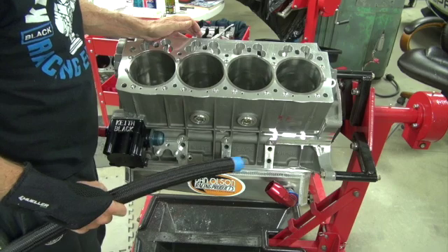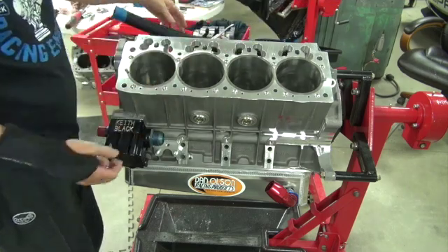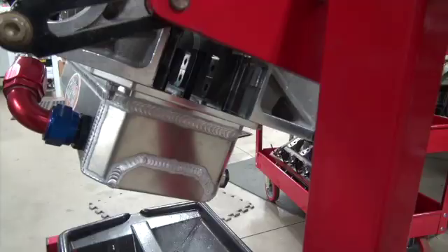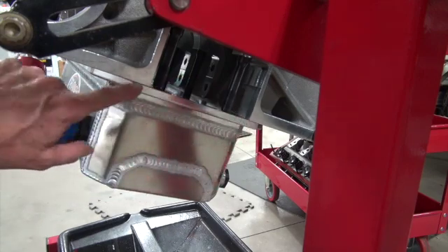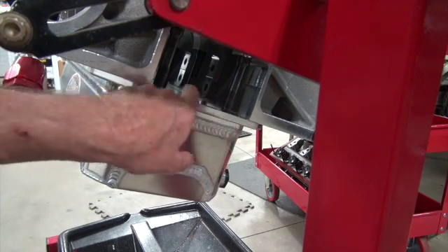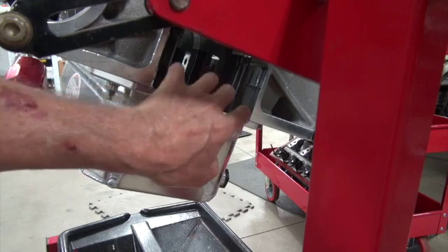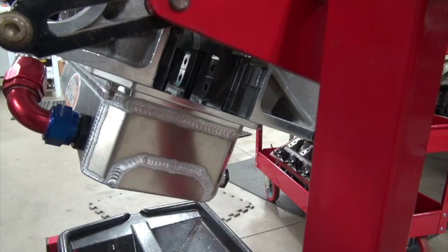We really don't need a top-fuel oil system on a test stand, but I don't care — it looks sexy. You have to get what you want. I also noticed this oil pan looks like it's hitting the number five studs by about 15 thousandths, and while the pan gasket should be thicker than that, you just wish it wasn't touching so close. I might want to spot that with a little mill just to make you feel better. Hopefully the pan gasket is thicker than that, but you wouldn't want to find that later.